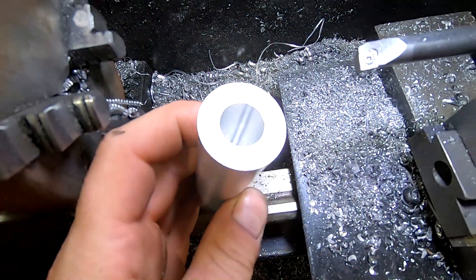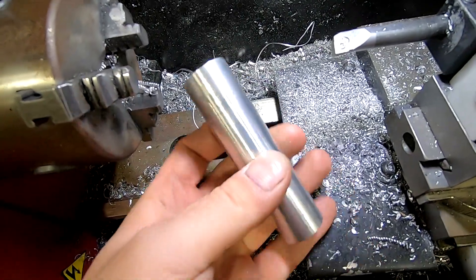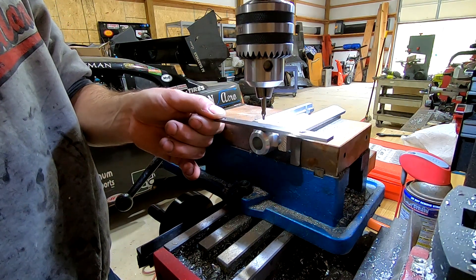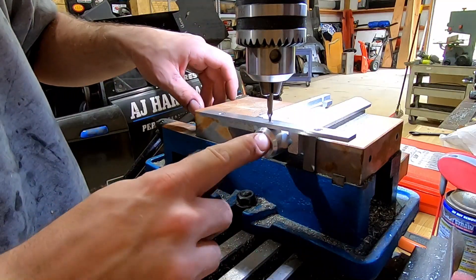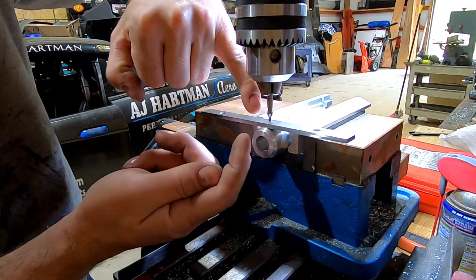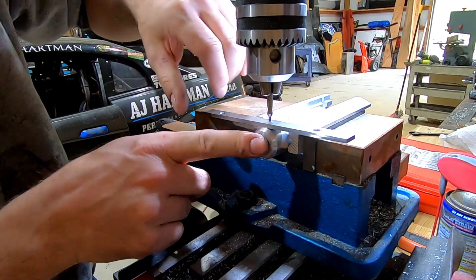That's pretty cool — pretty good finish on the inside actually. I'm going to stop real quick to share a little tip I picked up. I wish I remembered the video I saw this in, but with the round surface here and a drill bit point, getting those two to meet up properly for centering is the key.